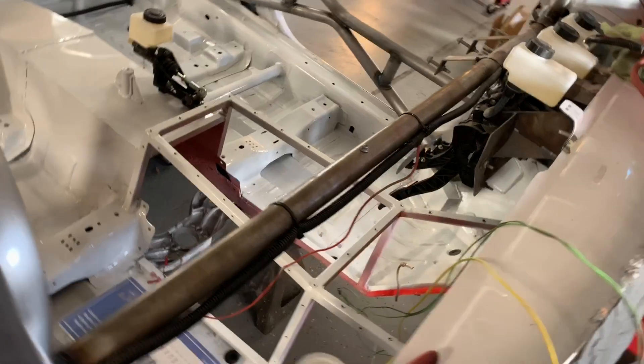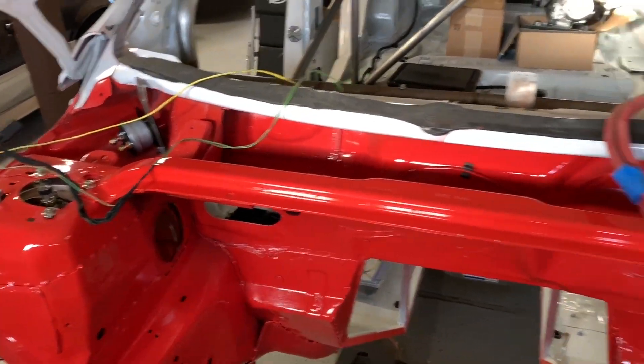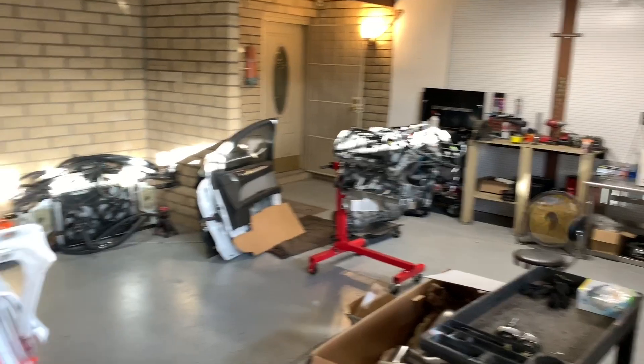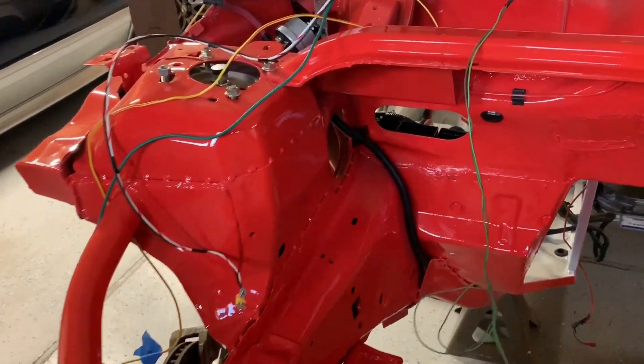I started to get some of the wiring a lot more neat. That's for the windows and that's the power feeding to what will be the ignition panel for the windows. Getting the harnesses I made kind of pre-organized and jogging my memory on what I had everything — I really didn't label anything but I have a good idea of where everything went. All the power feed — this is probably 95% of the control pack stuff. I took the engine harness and laid it over there just to get out of the way because I really don't need it till that little guy is in here. I just want to show how neat I kind of wanted to make things. Got the power distribution box in there, the feed going eventually up to the kill switch. It comes and kind of sneaks through this convenient frame rail area, and then I got a nice tie there and it goes through a hole here. I shrink wrapped that — I'm going to shrink wrap all the ends I didn't before, because the wiring prior was sort of a dry run, so I'm just going to do everything as professionally as I believe I can.